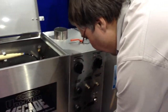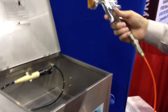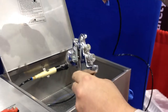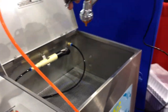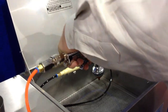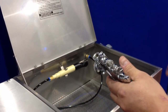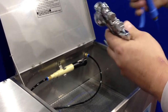On the right-hand side, we have our waterborne cleaning. We take our gun, connect the whip hose. Our water tool goes into the fluid opening. We step on the foot pedal, flushing the gun, watching it get clean, spraying it out into this tube. There's also a brush if we wish to brush any overspray. And very important: follow up with a blow gun to blow it thoroughly dry.